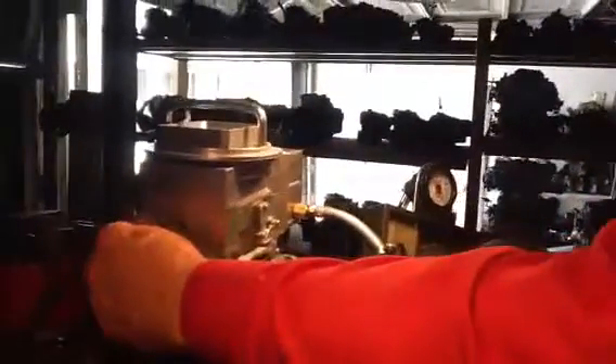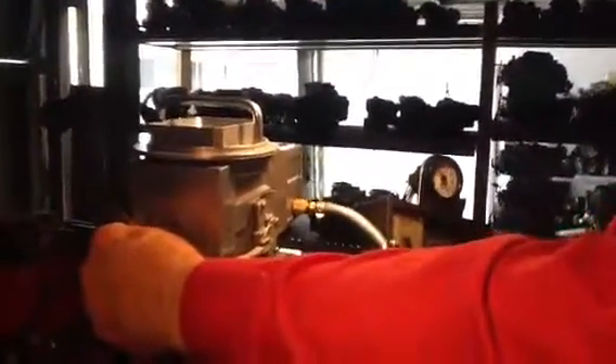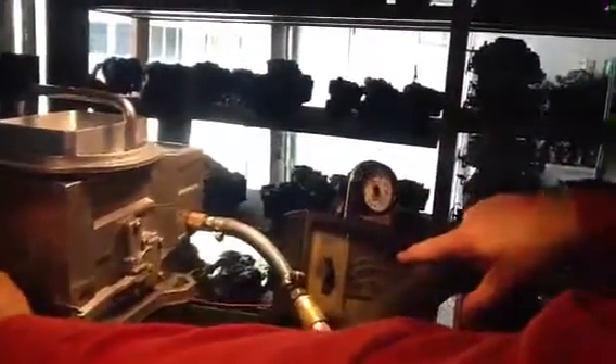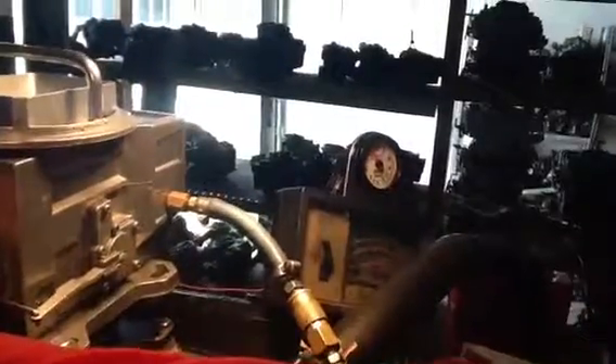This is the Predator. This is going to go on its shelf for the next buyer — nobody's assigned to it yet. That's a mixture screw at 12 parts of air to gas. Right there is the mixture screw, there's the idle speed, that's all there is to it. That thing is idling a little over 800 RPM — that's very rare.